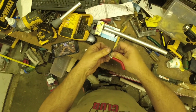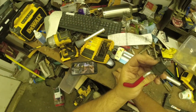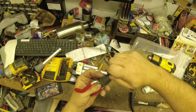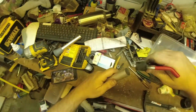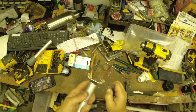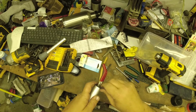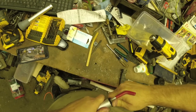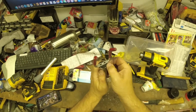Okay, now I'm going to start assembling. So I take the tool holder and put the bolt through it, and then put that through the rubber stopper, put the washer and nut on there, and snug it up a little bit. Then I'm going to insert it into the outer part of that lower crutch portion. And I need to make sure that it's seated in there real good. Pretty much bottomed out right to the tool holder. You may need a little bit of persuasion with a hammer.